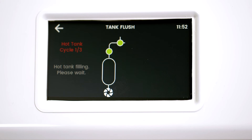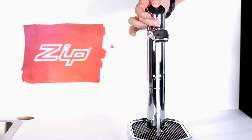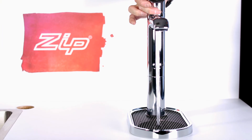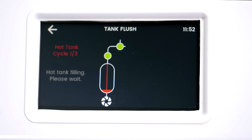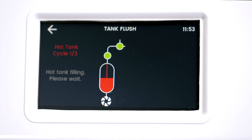Next, we need to perform a tank flush. Press the play symbol to start. The screen will show an image of the boiling tank and this tank will slowly fill up. Once it's full, empty the tank out by using the tap or faucet — you'll need to activate the safety button and the boiling button to do this. Dispense water into the sink and every 15 seconds the flow will stop. You need to dispense water up to three times for each flush. Once the water stops flushing, look at the screen and it should indicate that the boiling tank is refilling. The tank needs to be flushed three times to complete this process.